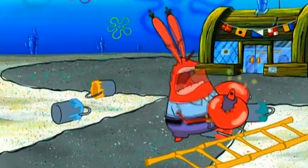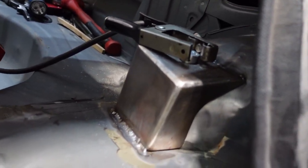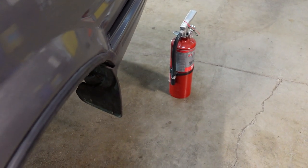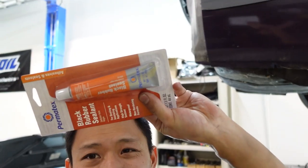I'm having a pretty rough, frustrating welding day right now. One pro tip on a coupe — the back seats fold down. I think that's the only way I'm going to get to the back side, so I'm going to be welding from inside the car. I got my welding blanket so we don't burn up the customer's interior, fire extinguisher at the ready, and we got people next door so I can yell. Let me finish up the driver's side and hopefully the passenger side goes much better. Once I do the finished welding, I'll add seam seal and then lay down paint.